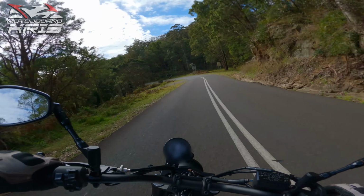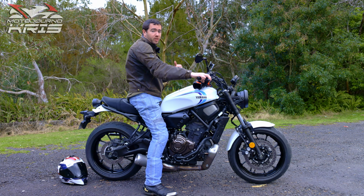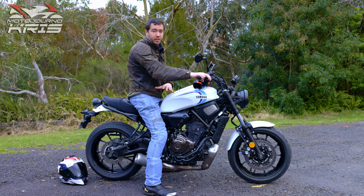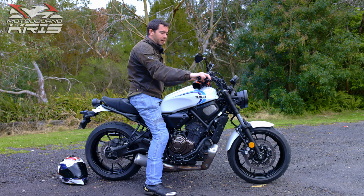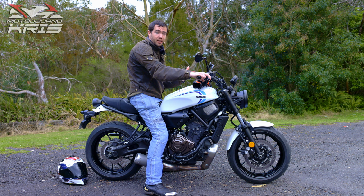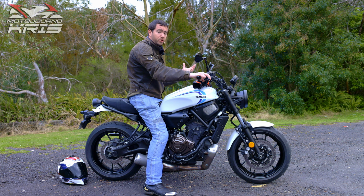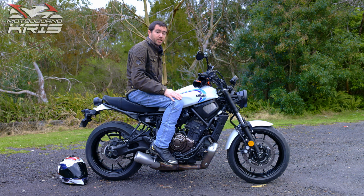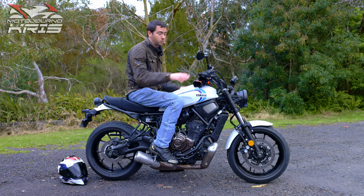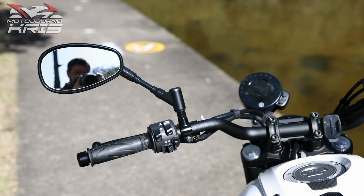I've got a full video up on ergonomics, but I'll give you a very quick look of me on the bike. I'm 180 centimeters, 32-inch inseam, both feet down flat in regular boots, easy reach to those bars, it's quite relaxed. The bars are a little bit taller and a little bit further back than on the MT-07. The seat being taller, 835mm seat height, may be an issue for shorter riders, but generally speaking, I think it's a bike which will suit most people, and it's nice and narrow between the legs when you're putting your feet down, and you've got a nice easy grasp onto the tank, and it's quite easy to lock in as well, certainly when you're getting your toes up on those pegs. So overall, I find the ergonomics very, very inviting.